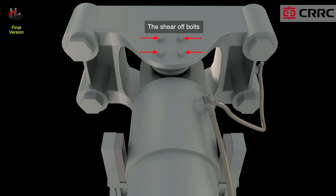The shear bolts define the predetermined breaking point between the coupler and vehicle for impacts exceeding the predefined load. In case of a heavy impact, the shear bolts shear off. The force flow is interrupted and the coupler shank is guided through the bearing bracket into the vehicle.